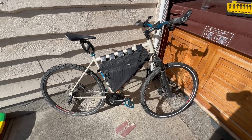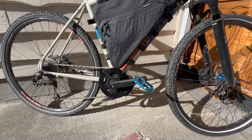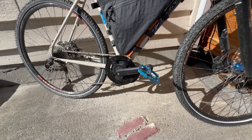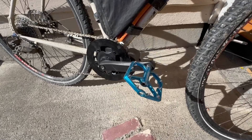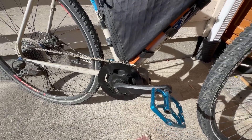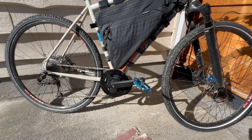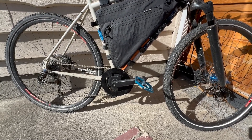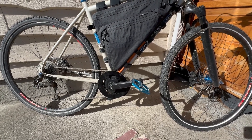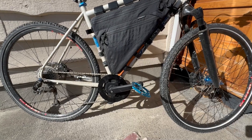This is my bike with the DM02 motor that I modified. I've got about 500 kilometers on it. Unfortunately, something has finally gone wrong with the motor — it's not functioning anymore and it's making quite alarming noises. I'm going to assume it's the nylon gear that I've finally knackered. It's done pretty good to get 500 kilometers with the power I've been pushing through this, which has been up to two and a half kilowatts — I pushed it up to three at one point. I've been trying to be reasonably careful with it, but eventually going up a hill on full throttle, something gave.